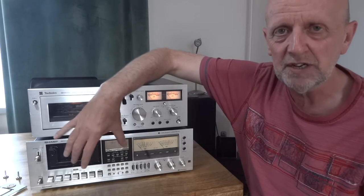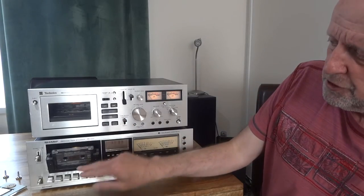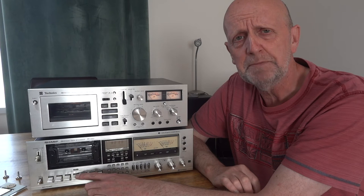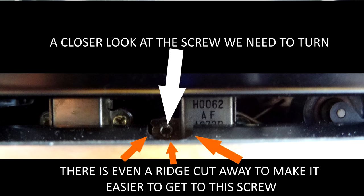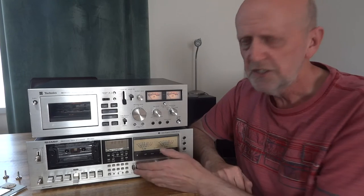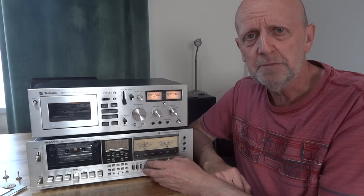A lot of decks are fairly straightforward. All you've got to do is get that cassette that sounds pretty bright, put it in the machine, press play. Best to get a pair of headphones — if you haven't, have your speakers on a reasonable volume. Turn the Dolby off and your equalisation to normal, so if it's a chrome tape just put it in normal position and turn the Dolby off.